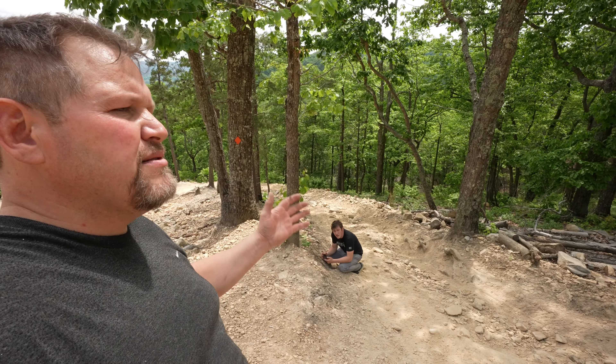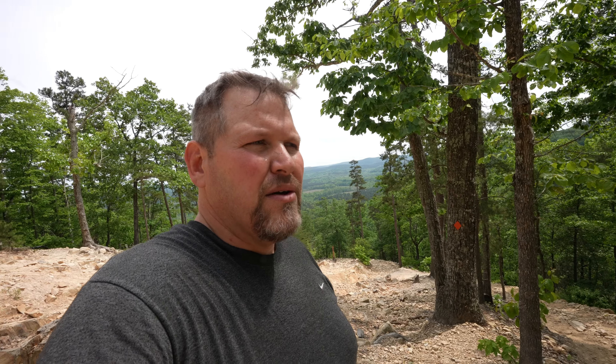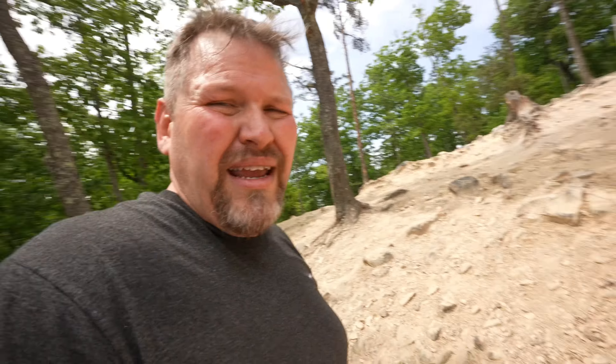Both of us walked right up it at 10, 12, 15 pounds. Harley, what's your take on air pressure? A guy with a Rubicon running 285/75R17s, load range C BFGoodrich All-Terrain — I think he's about right at 15 pounds. You can see we're both running 10 and you're not hardly losing anything. My rash rings are gone — I'm pretty aggressive, I take whatever line I want. I think we'll mess with Harley somewhere between 10 to 12.